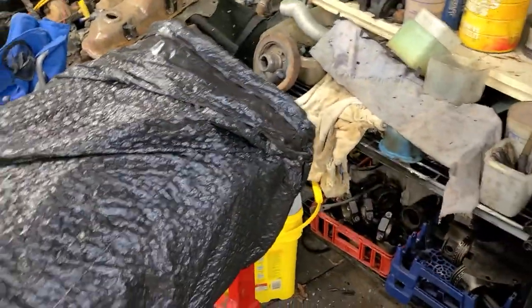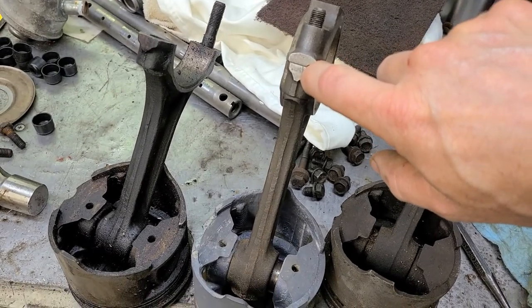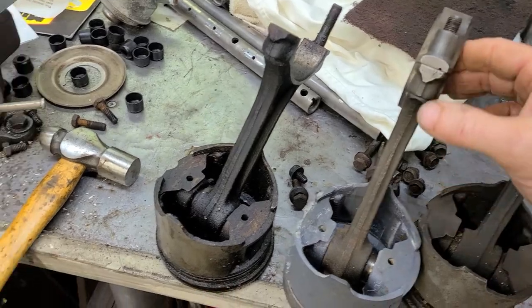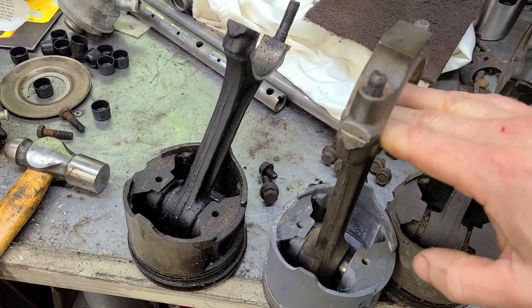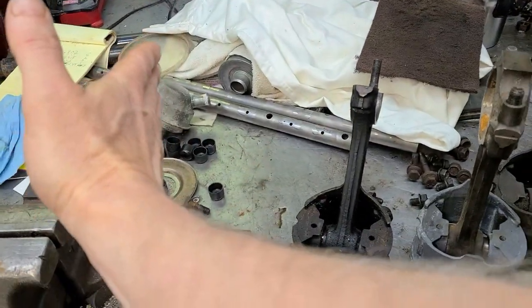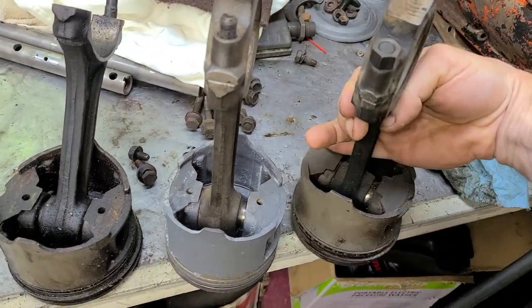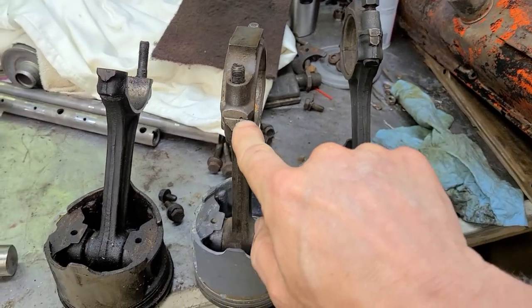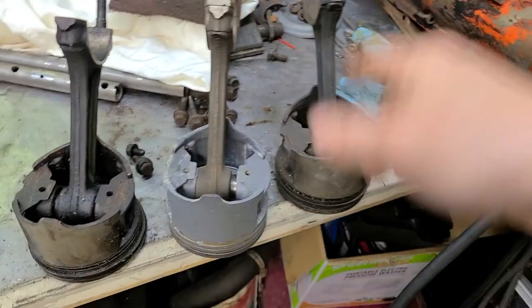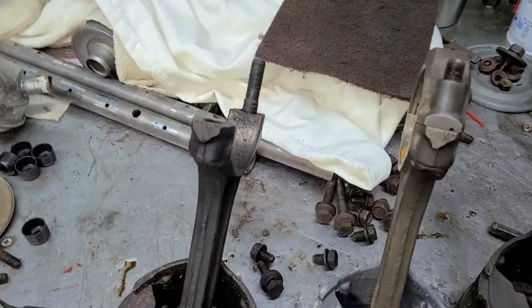I've got the oil pan on this — I was going to take that off and show you, sorry about that. But this notch will face the inside of the engine. Let's say our crank is here and this is attached to the crankshaft — with the front of the engine up here and the flywheel back here, this will face to the inside of the engine. The reason they do this is not just to keep track of parts, but to lubricate the cam and the lifters. The cam and lifters do have their own lubrication system, but this is a nice way to help keep that lubricated — right along with these holes in the pistons too, near where the wrist pins are.